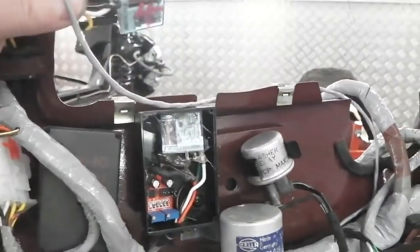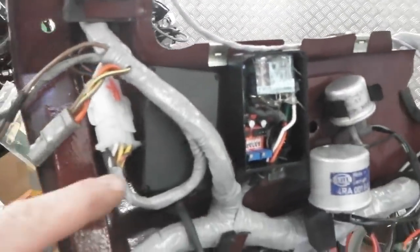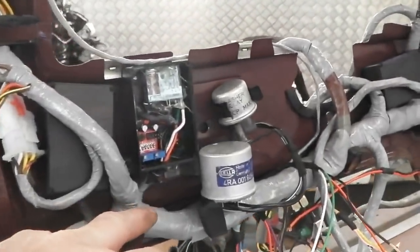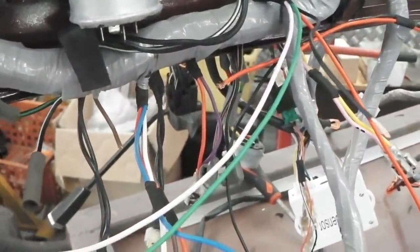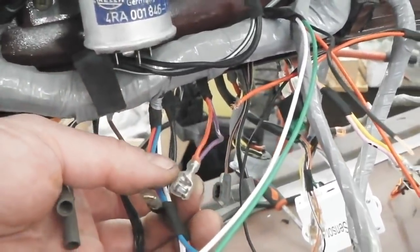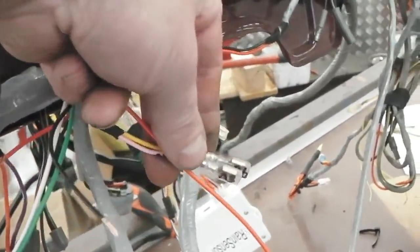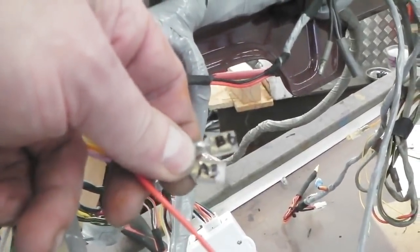One more relay to box up there, that needs its box, but you can see how when we've planned it, things all land. Luckily, a little bit of luck and a little bit of measuring, but most stuff lands. The main trunk of the loom there, and then the tails coming out at the bottom, they're each one's from each fuse box. You've got two levels, accessory levels, first turn of the key live, and then second turn of the key live, different ones. They're written on the connectors, which fuse box it goes to. So A for fuse box A, B for fuse box B, then up to six fuses, one to six.